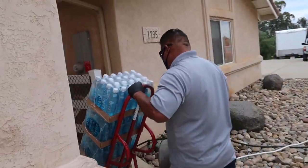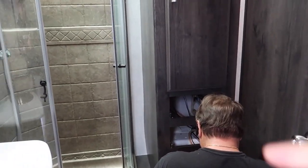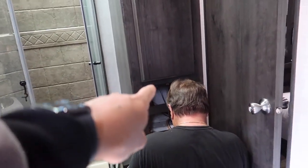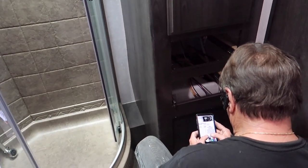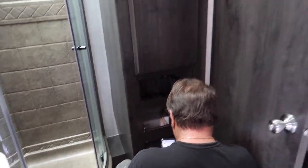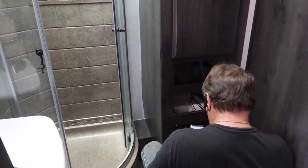The motor is done and everything's put back together. Now you have to go into the controller box - in my RV it's in the bathroom; pull the drawers out. You can see it has a reset option and an alignment function. You've got to sync the motors properly so they go in and out evenly. That's what Bill's figuring out right now, and then we should be all done.